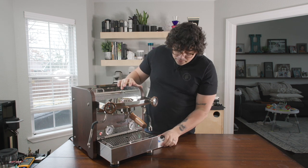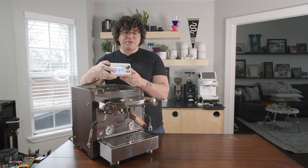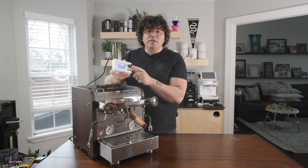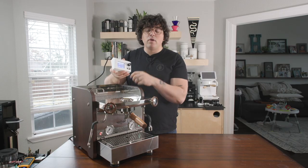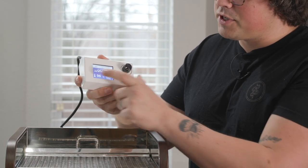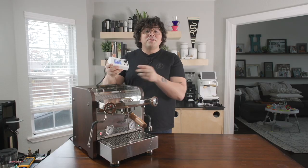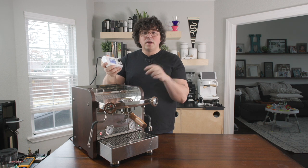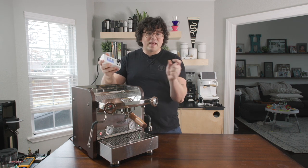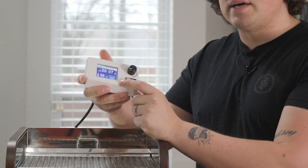This is probably the most unique part — this little controller you get with your machine. This knob controls the pressure, so this is a fully capable pressure profiling machine. It works more like a potentiometer — it modulates the voltage going to the pump to control the amount of water coming out. On the controller you can set the time, set the temperature by clicking up and down — I have it set to 96 degrees. You can set a turn-on time, turn-off time, a sleep mode. You can set up two different profiles using pre-infusion. You can put a blind basket in your portafilter, measure the time it takes for pressure to build, and use that as your quick fill time prior to the low infusion that begins the shot.